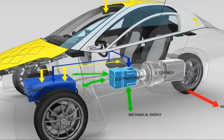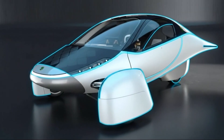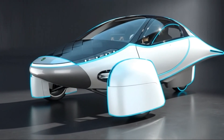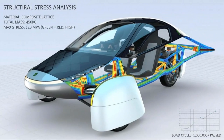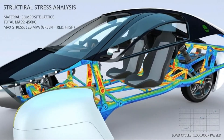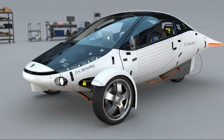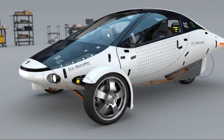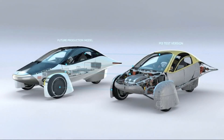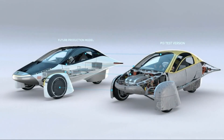Magnax created a spin-off company called Traxial, and they're claiming some extremely impressive performance numbers. They estimate that their motors achieve around three times the power density of standard motors, and they even suggest that vehicles could gain up to 20% more driving range because of the improved efficiency. They state that their electric motor efficiencies are around 96%, while most radial flux motors usually land below 90%. That difference may not sound huge at first, but in the world of electric vehicles, single-digit improvements can translate into significant real-world range gains.